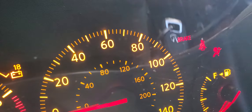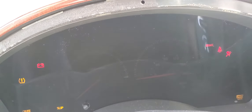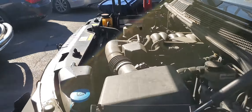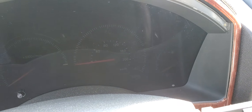You need to add a token — this machine consumes tokens. Turn the key off. This car is old, so I'm going to click okay for new key. Insert the key, turn the ignition on — that light is supposed to go off. Yes, the light went off. Now it says turn the key off, then turn the key on. It's supposed to blink five times: one, two, three, four, five. Turn it off again — it is registered.